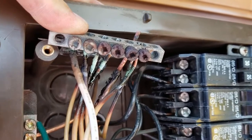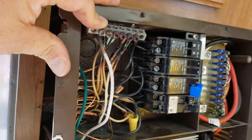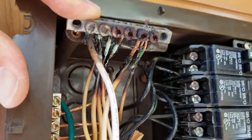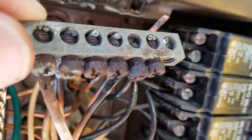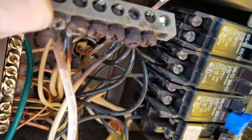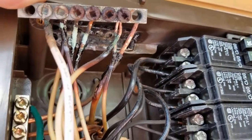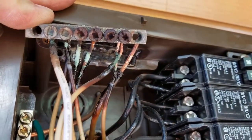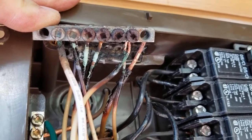After a season of not using the camper, I went ahead and plugged it in and started to have smoke coming out of the power box panel. I quickly unplugged everything and took the panel cover off. Inside, this is the bar for the common wires and down here is the bar for the ground wires. If you look closely, you can see the screws are severely corroded, and that caused increased resistance and smoked up everything inside. Had I not stayed around the camper, this would have been a catastrophic event — these campers don't survive fires very well.